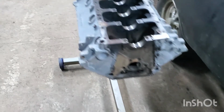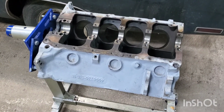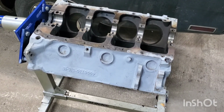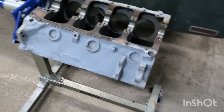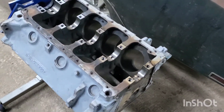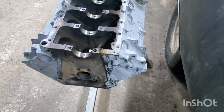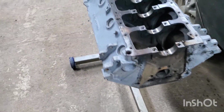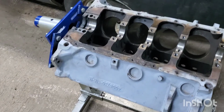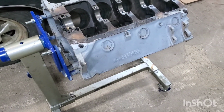And I got to do the same thing with the engine block because there was grease and stuff on the engine block, and it's been sitting, even in the garage, and I had to use the degreaser to help clean it off. So I'm gonna use a blowtorch to singe it a little bit and ensure the surfaces that'll be taking paint are good enough to hold the paint for the long term.